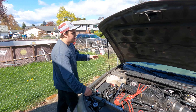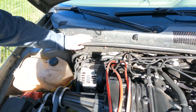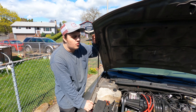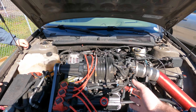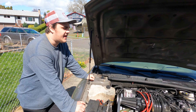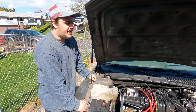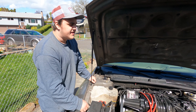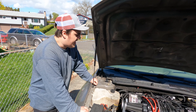What we're going to do is take the head bolts out one by one, put new head bolts in that Tristan already bought, then put plumber's tape around them, put them in, torque them, heat cycle, and torque them again once it's back in the car. For the oil on the back specifically, we think it might be a lower intake manifold bolt that goes through the valve tray. We're going to take those out on the backside and probably just use plumber's tape — we put PTFE paste on most of the bolts, but we think we may have missed that one. I've seen plumber's tape work better than PTFE paste in some cases.